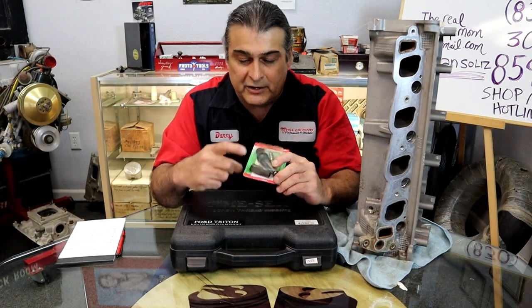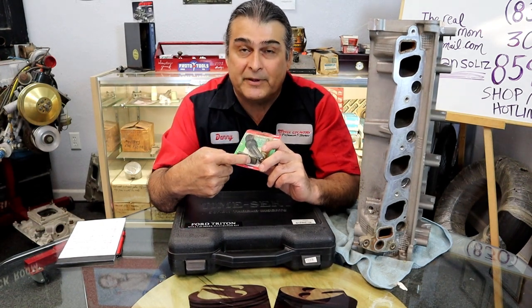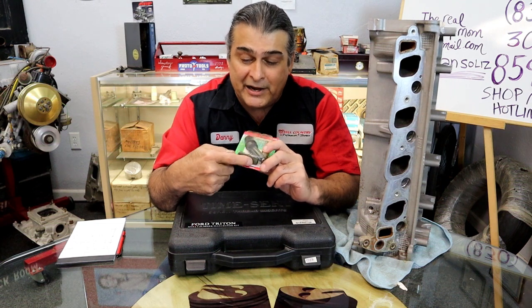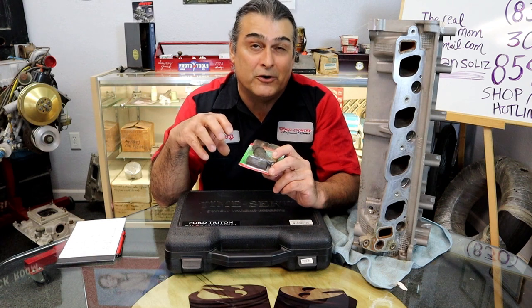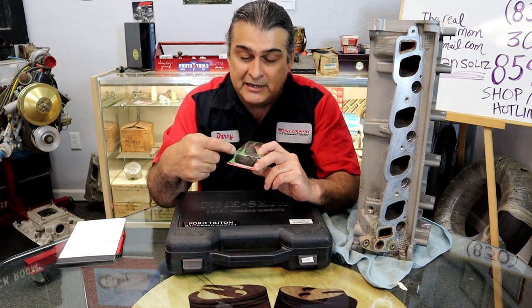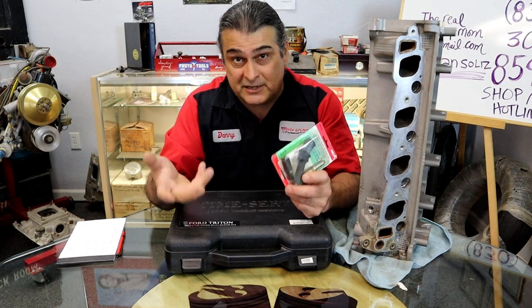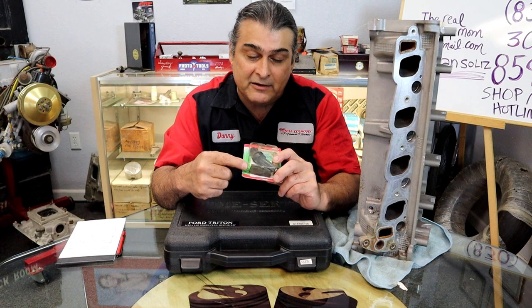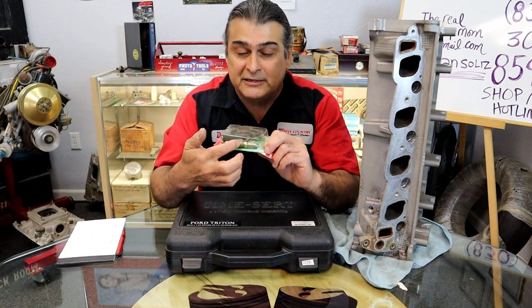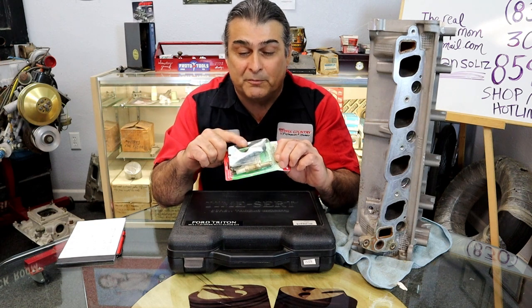It's a steel insert that's oversized and self-tapping. You just lubricate it and stick it in there, and you're basically, I don't want to say cross-threading, you're making new threads and screwing the steel insert into the head that was stripped and not holding a spark plug. Once that steel insert is in there, it's in there for life, and there's a special spark plug, a little bit longer, to get back into the hole like it should be. It even comes with the boot.